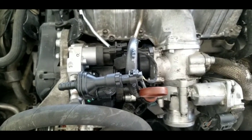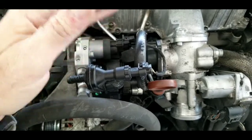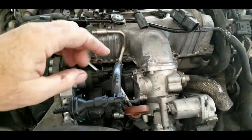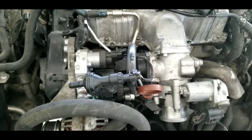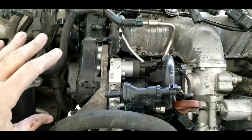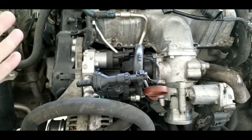So there probably is not a fix for the Ford, and it's pretty much a ticking time bomb. A lot of people say it's because of the fuel — and it is — but you really can't have enough filters in there, and there isn't anything holding that roller from turning sideways. All it takes is anything that gets that roller sideways and you'll wipe out your fuel system. The roller gets sideways, starts putting metal shavings into the fuel system, wipes out all your injectors, then the metal shavings go through the return line into the fuel tank, filling it with debris that sticks on the magnets inside the lift pump and any secondary pump — ruining the entire fuel system.